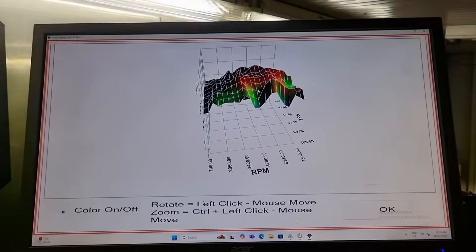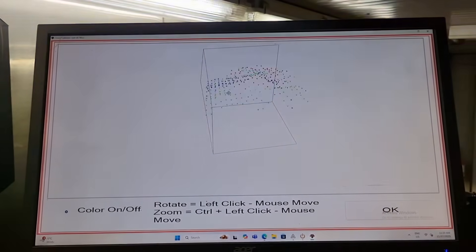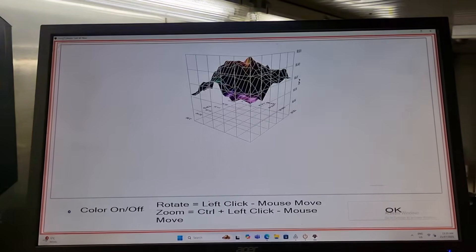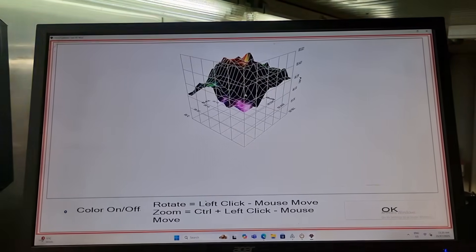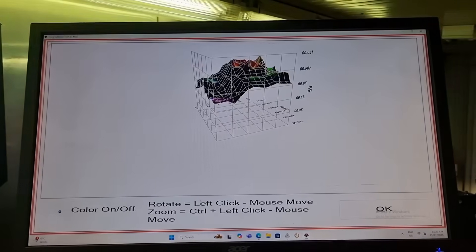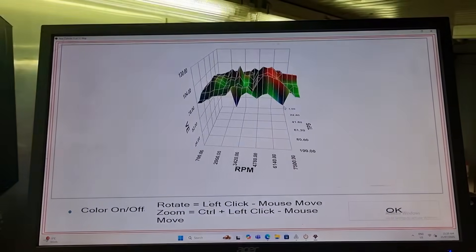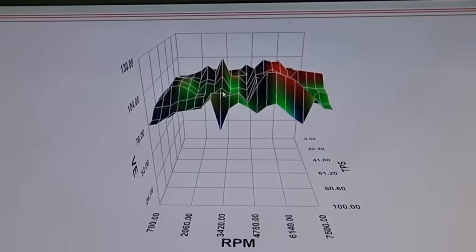There's way too much fuel there to start with — probably got to take 20% out of there. But I can see if that's true to the target, that's way too rich. On the roll-on there are some big spikes and troughs, a big gully in it. This area doesn't look too bad where the idle and cruise speed is, but it is quite rich in the next column across. We won't know until we start looking at it. The rear cylinder — let's just have a quick look at that as a graph too.